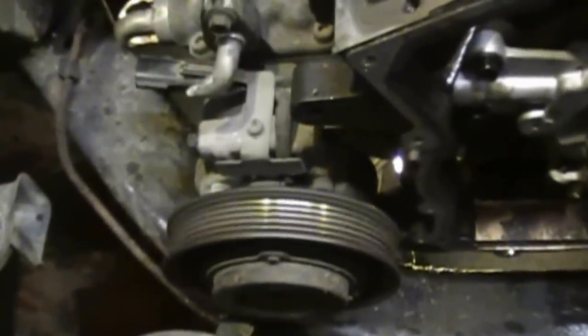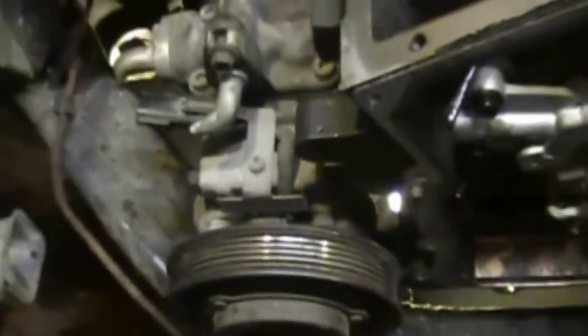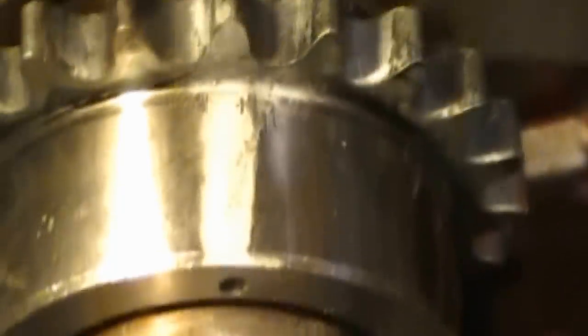I'll also get my AC pump on. If your pump is bad, now would be a great time to replace it - it's easy to do. This one only has three bolts: one here, one at the bottom, and one back on top. I went to the junkyard and got this for $40 - it seems in pretty good shape. Now, I wanted to show you one more little trick: I put a little paint on the crank where the hole is to give me a better idea where the timing tooth is. Here in a few minutes I'll go ahead and put the chain on and show you how I line that up.